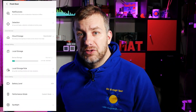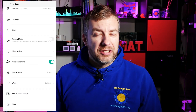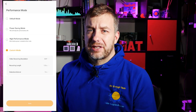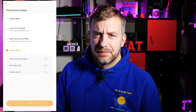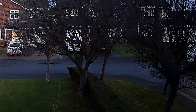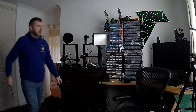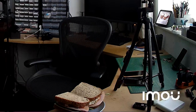Another thing is that you cannot set this camera to continuous recording, even if it's connected permanently to a power supply. I hope Imo addresses this, because I don't see a reason why not — especially if the user wants to use the camera that way, they should be given the option. Looking at the footage from the camera, I'm quite impressed. The sensor performs well in both indoor and outdoor scenarios, and that extra resolution comes in handy, especially when you want to zoom in on an object, capture face details, or read a registration plate from a vehicle moving across the road.